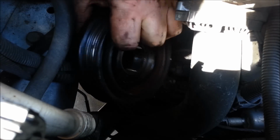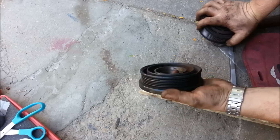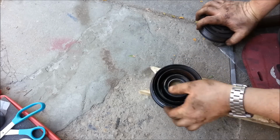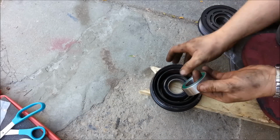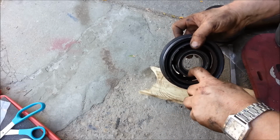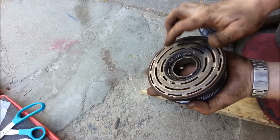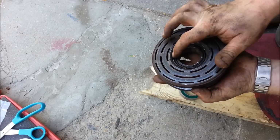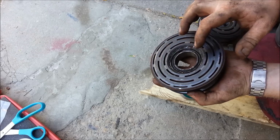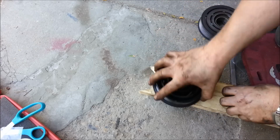And it is off. There's our faulty bearing. Here's the one off the car, and you can see, here's my new bearing. And so by quickly looking at it, I can see that on this inside edge, there is actually a lip. And on this outside edge, there were actually little push down pieces of metal that they use to kind of retain the bearing. So on this particular style, the bearing actually pushes out through the front.